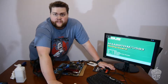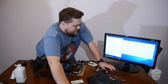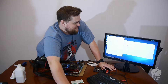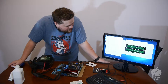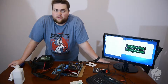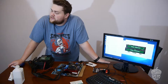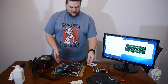Clearly I didn't short anything out because it posted. So what are our temperatures like? Our idle is around 35–36. Let's put it under stress test. The temperatures do look better already — our stress test temperatures right now are 53. They're slowly climbing, but at this slow climb I don't think we're gonna reach the same 63 that we had before. So there was a benefit, I think. We'll let it run for a while — we may have just improved this computer.